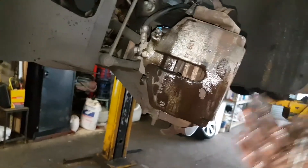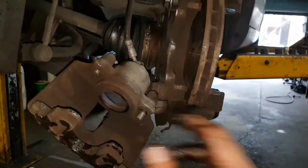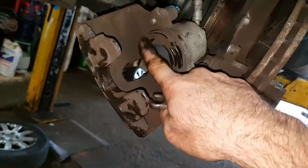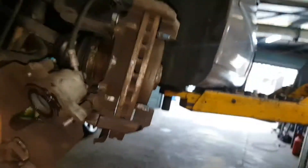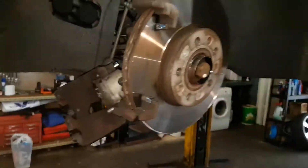At the end, put water on it to get this off. The more stuff you spray on these rubbers, the more they deteriorate. Another note: if you're putting all these adhesive glues and stuff, they always tear these rubbers. These are really good quality rubbers here but they tear them. The only thing you should be putting on here is actually the synthetic type stuff - if you want to keep those seals nice. If you want to spray the whole thing with brake cleaner and paint your calipers, that's great. But as a workshop doing the job in a time-effective way, that's the way to do the brakes.